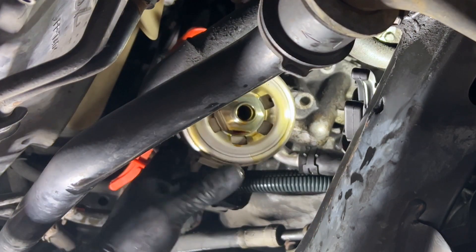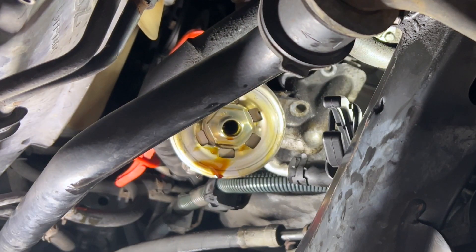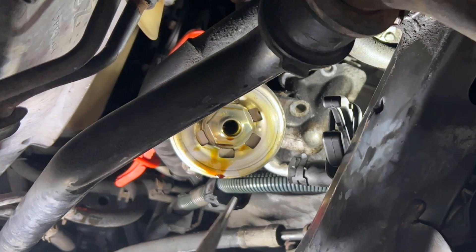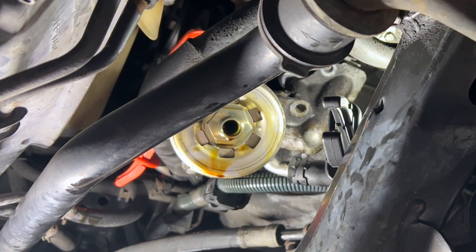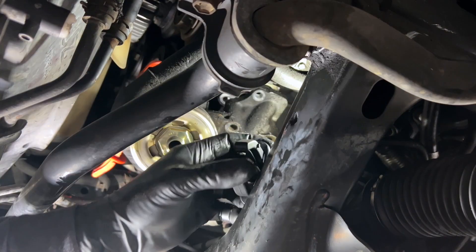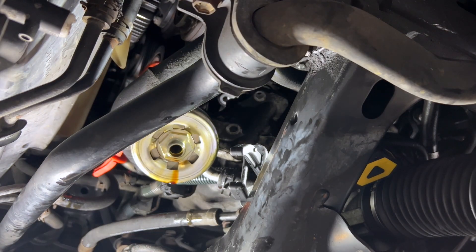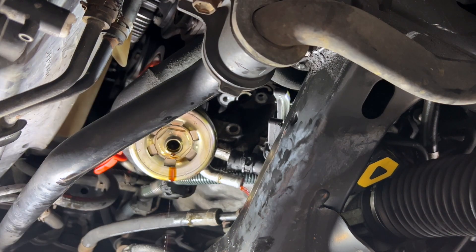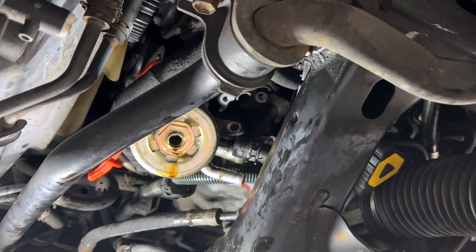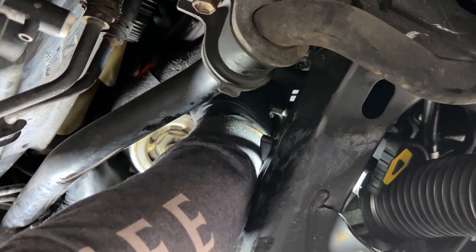We're off — now I'm going to release the lines. Hopefully we don't lose a ton of fluid, but I've got a catch can down here ready just in case. No way around this one — you're going to see me going back and forth. This was a pain to get the clips just right; none of my tools sit perfectly because of how much stuff is in the way. Take your time, don't rush it. This was actually the easy one — the harder one is the small line up top, so be prepared for a bit of a struggle.